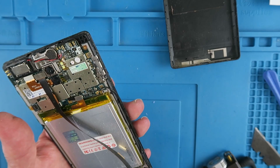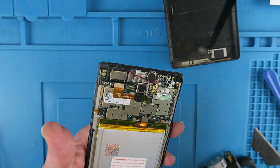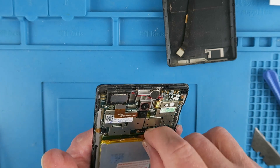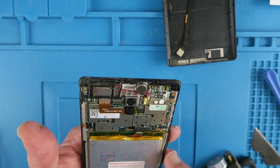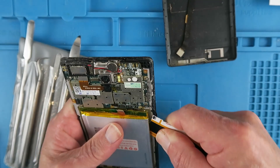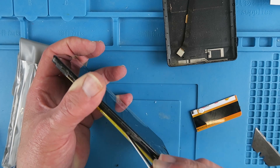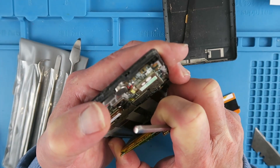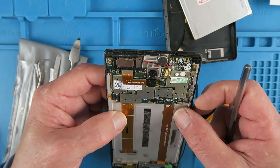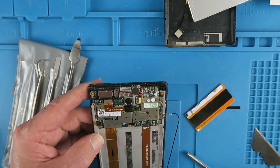This cable here appears to be a camera. Put that to one side. There's a screw missing here, it looks like. And that will be the battery connection there. Sometimes an old credit card will enable you to get underneath the battery. We haven't damaged them, and we have a cable here which should just pop off. I think we can take out this board if we remove those two screws.